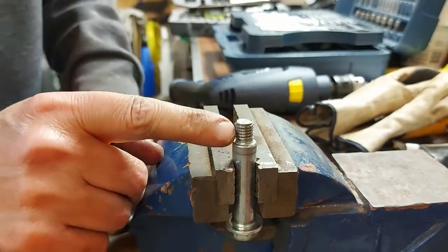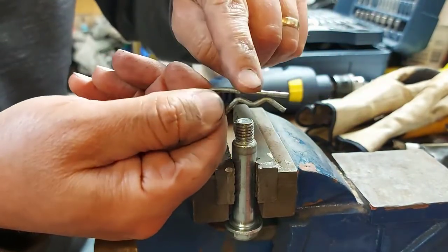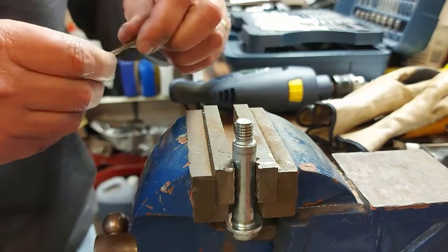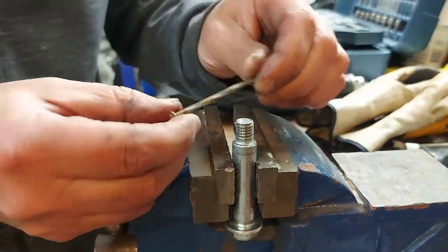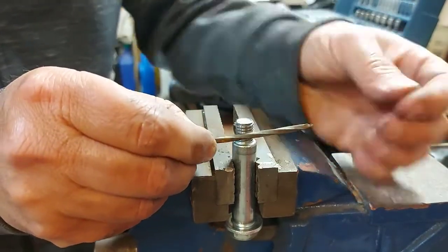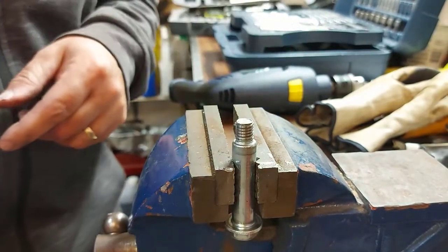What I'm going to do is drill a hole through the bolt, and then use something like a cotter pin — just put it through here and that'll stop the bolt from coming out and your wheel falling off. Or you can go old school — you could cut some wire and put it through the bolt, then just bend it. That would also stop the bolt from coming out of that hole.